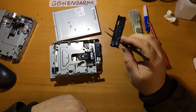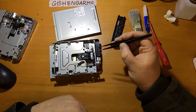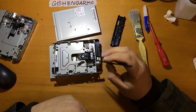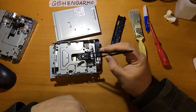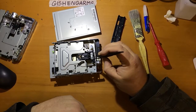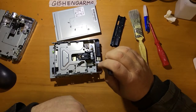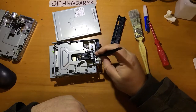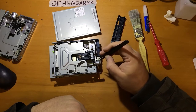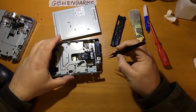If you find that your drive's been making a lot of nasty noises and giving you errors, then usually it's a mechanical issue, and usually it's about moving the heads around. So the way to test that really is to plug the thing in to a machine that you can use to test, and try and copy a whole disk's worth of stuff and try and get it to move the heads all the way back and forth, etc. And you'll see if things are getting stuck. You'll see if the motor is not turning properly. You'll start to hear where in the drive the problem is once it's open.